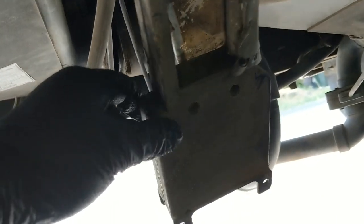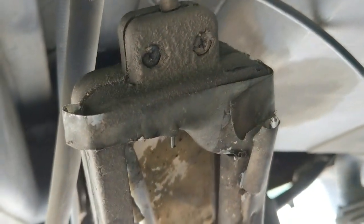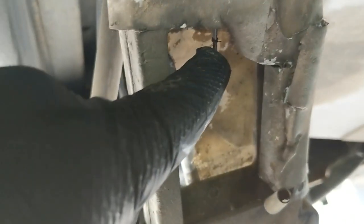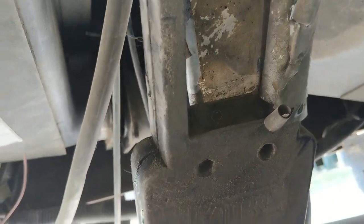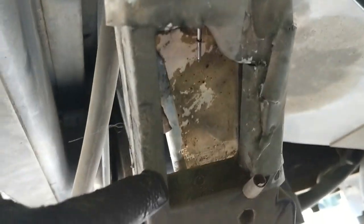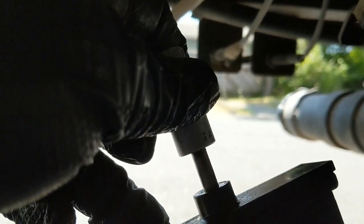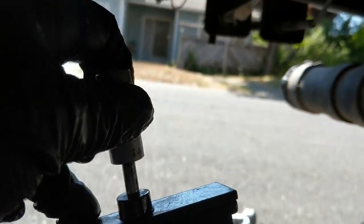This is the cable assembly that goes on to the top of the valve right here. You can see it's usually sealed up with some sort of tape where the cable comes up and actuates the valve. I ripped mine open because I was having leakage problems and thought if I could push it closed manually that might help. But that's not going to help if there's something actually in the way of the blade valve. You have to get this thing cleaned up and then put back together and resealed, otherwise gunk will get into the shaft you just lubricated and it will become super hard to close.